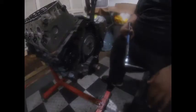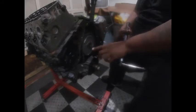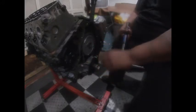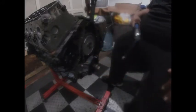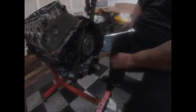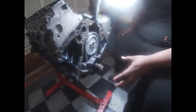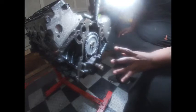What I'm going to do is torque down all these bolts to 26 pounds. I already spun the timing chain over, so now I'm just going to torque everything down to 26 pounds of torque. Now I'm going to put the engine cover on here.